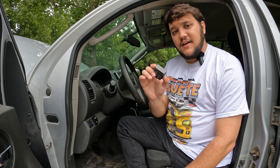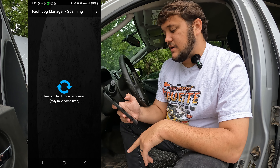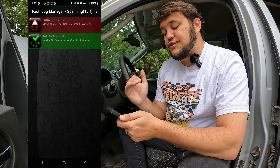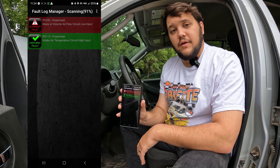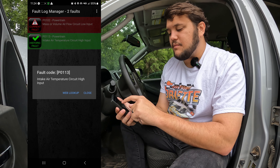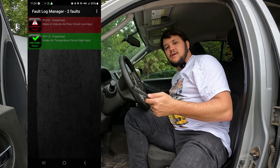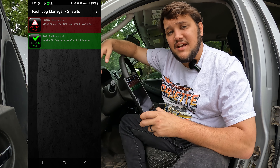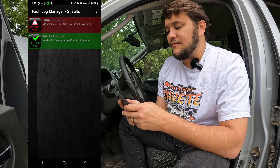Let's go ahead and check the quality of the data we're getting. I've got the VPeak here — we're going to plug this in and see what it's giving me, what it should be giving me, and what I'm going to do with that information. From the very start of the test, it's actually found two fault codes already. It's still running, but I like that it says hey, I'm not done, but here's what you should know right now. The Torque app actually organizes this data really well — it says you've got a mass airflow sensor code and an intake air temperature sensor code. One thing I don't understand is it's telling me I have a historic fault, which is odd because I've never had a fault code for this. Also, it's not telling me about VDC, and it didn't find my dead TPMS sensors. So again, this thing would be fine for just very quickly reading check engine lights and trying to figure out what you're dealing with.